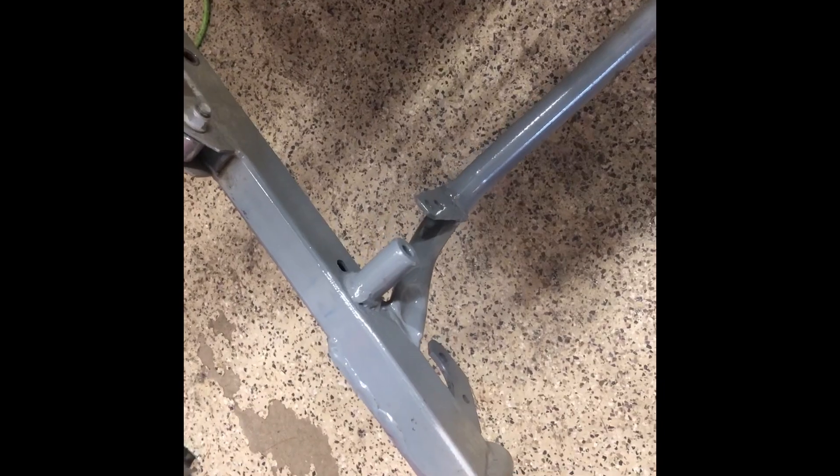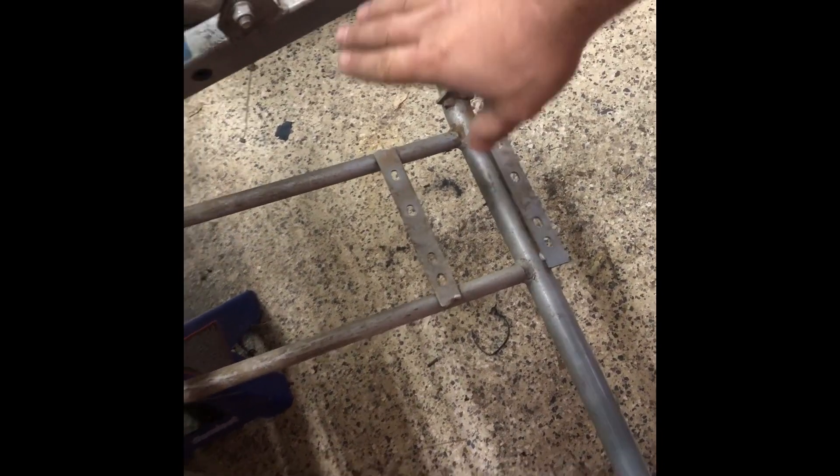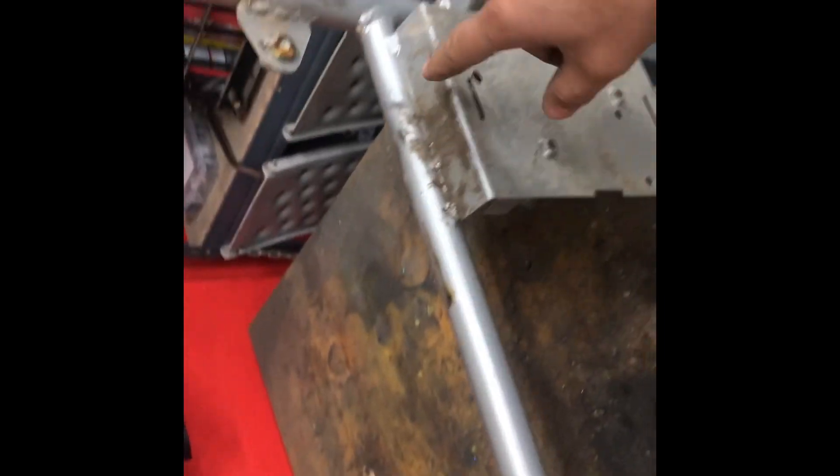Got some paint on and it matches pretty good. I pulled off the little wheel mud guards — I think I'm going to end up popping off this whole subframe once I start doing the mock-up of the engine. I'm just going to put a couple standoffs up here. From this position to the top of this frame rail is about seven inches. I don't quite have enough material because I'm trying to reuse the original piece of metal I cut off — this is 12 inches so I can make two six-inch standoffs, which will give me pretty much parallel with this. The engine would be one inch down, which I think is fine.